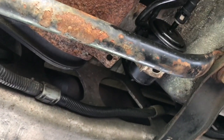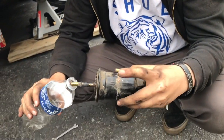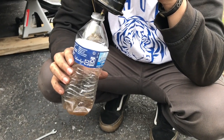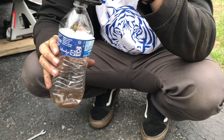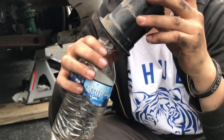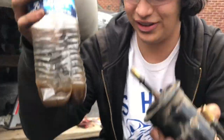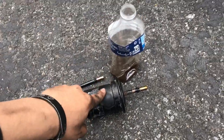Let's start her up and see if there's any leaks. So there's the reason why you want to change the fuel filter - let's find out how the gas looks in here. The point of this is to make sure you have clean gas. This one is old and it's been here for who knows how long, maybe it's the original one. Look how disgusting this gas is - this filter is old, it's been used and used, it's very dirty. Now it doesn't really let gas flow as well, filled with dirty stuff. That's why you want to change it - you don't want this dirty disgusting gas going back into your engine or your injectors. It is awesome, I'm glad I did it. It was a pain. You definitely might want to do it.